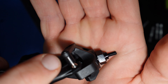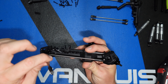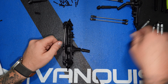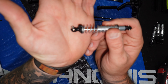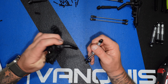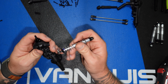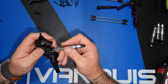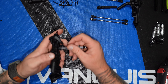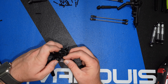Sorry about that — the camera battery died. On the driver side, you've got this stand off that goes here to make up for the extra room. Now you've got a functioning axle. The next step is to add the shocks. On the last video I told you guys wrong — I said the one with the stand off goes on the top, but it actually goes on the bottom, and that's the side that faces the axle. The stand off will face the pumpkin on the other side.